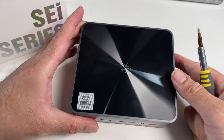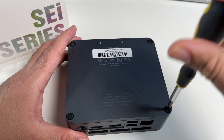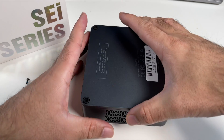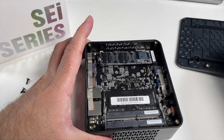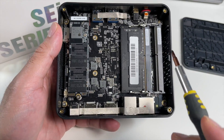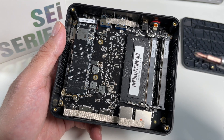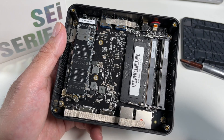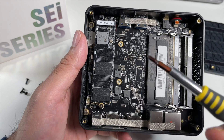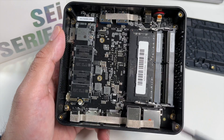Let's have a quick look at the internals and see all the upgrade options. We've got 4 screws at the bottom — taking the lid off — wow, look at that. You have 2 RAM slots; one slot is occupied by 8 GB of RAM, with a total supported capacity of 64 GB, so you could have 32 GB in each slot. Here is your M.2 NVMe at 256 GB, upgradeable to 2 TB, and if you replace the SSD you would need to reinstall Windows.